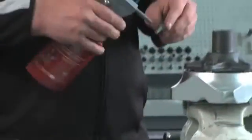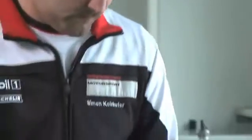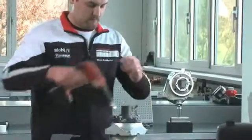The wheel hub carrier is fitted with 5 driving pins. Again, Loctite 270 is a vital component in the assembly. A peristaltic hand pump is used for precise application.